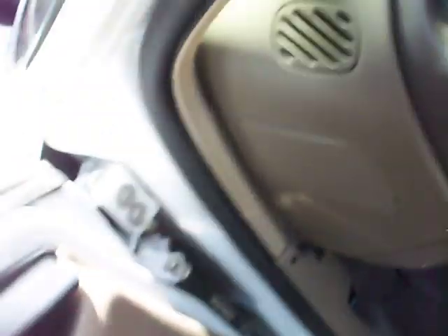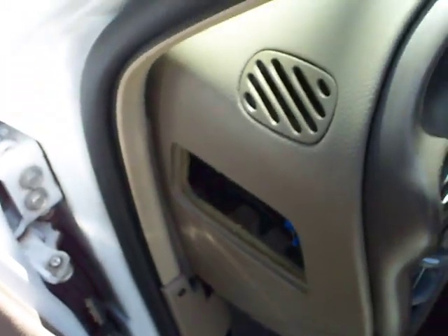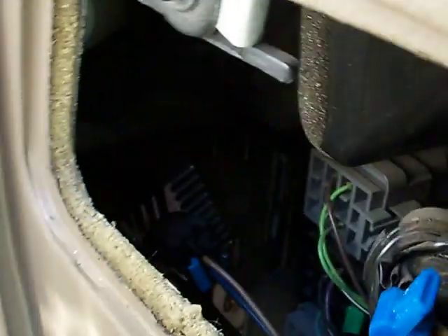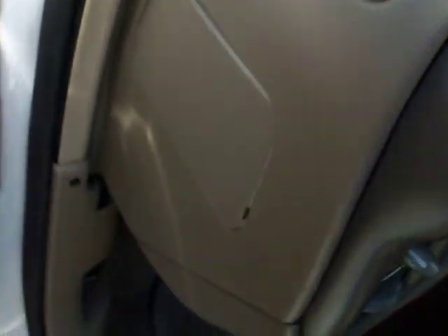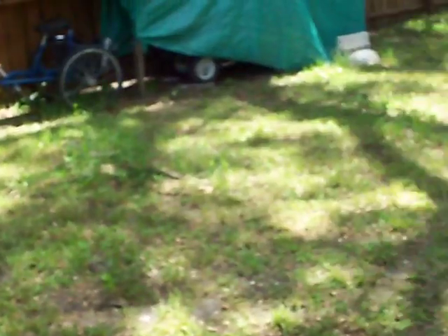Usually you want to try and use a flat tip screwdriver, but this is just one option. I just use my key because it works a little easier for me without having to run and find a screwdriver. Pop that panel off, and right there with the blue and tan wires is a heat sink that goes to your daytime running lights specifically. If you unplug that — just simply unplug it — then you can disable it. But as one person online has said, that's going to take quite a few tries because trying to get to that little bitty clip on the inside is damn near impossible.